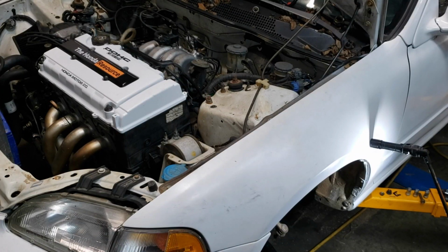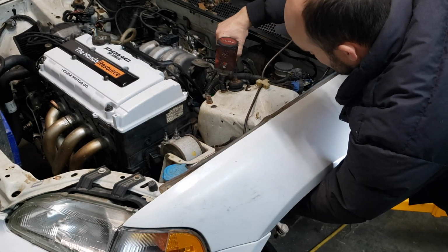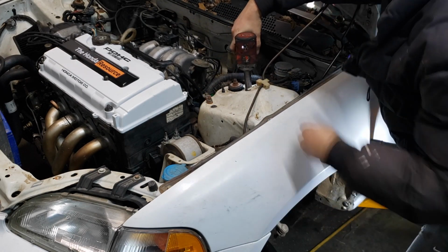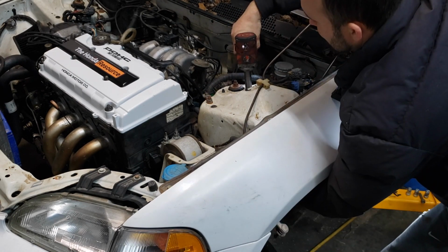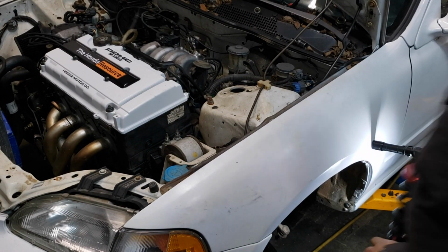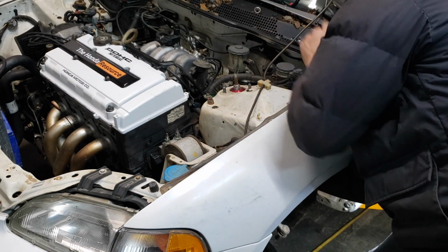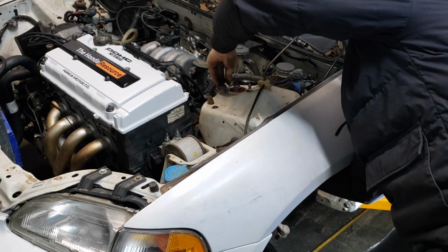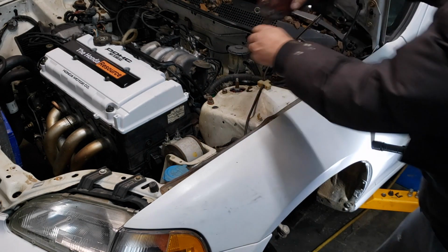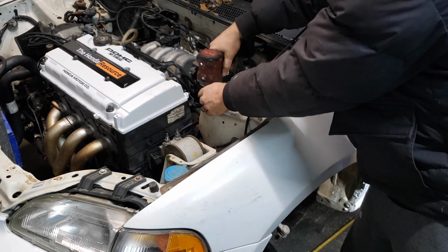So I'll go ahead and take out the shock first. I'll just stick my hand up into the fender well and hold the shock. Then reinstalling the shock, we just put it back up through there, and then put our 14 millimeter nuts back on it. Once we get those started, just tighten those back down. And I'll go ahead and take off the two 17s that hold the upper control arm.